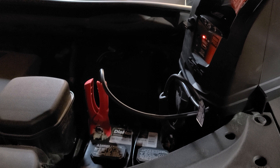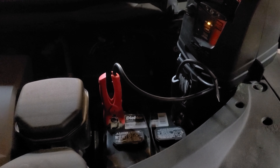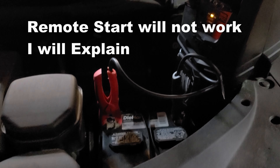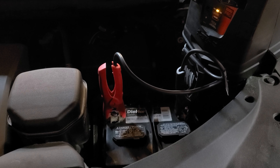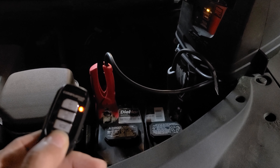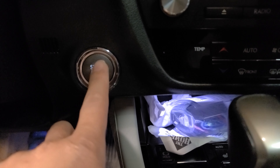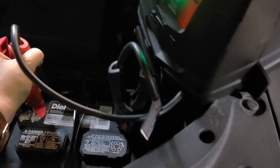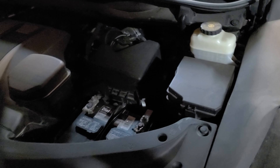So we're going to turn off whatever is inside the car. Since the battery is completely dead, I'm going to give it a minute or so to charge. Since I have a remote start on the car, I'm going to remote start it. Once it starts, I'm going to turn this off and then take off the clamps. I just realized the car will not start if the hood is open, so I have to be inside to start the car. I'm pressing on the brake — wow, it did start! Let's turn this off, take the clamps off — one, then the other — and let's put this back. And that's it. It worked.